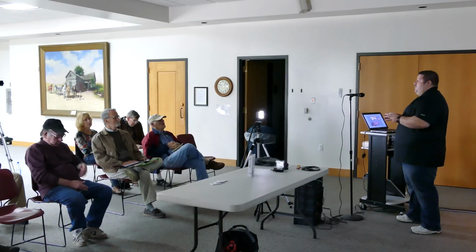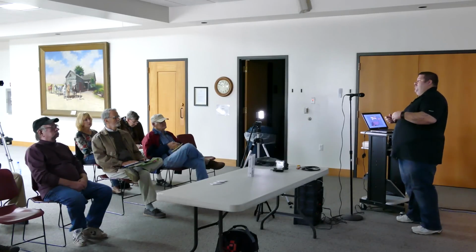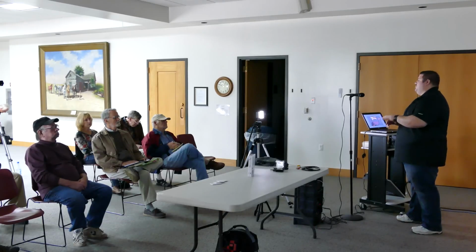Tapes utilize little fragments of iron, and that's what transfers to the tape, and that's what the VCR reads. And so when you put a magnet by it, you're going to pull those iron fragments away from the tape, and it's going to blank out your tape. And so that's something to be concerned with as well. That's how, as professionals, when we reuse tapes, we actually run them through a magnet, and that erases them. So that's another condition that you can get into.